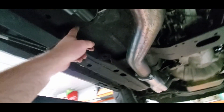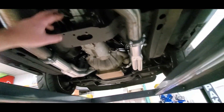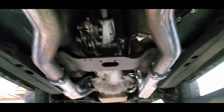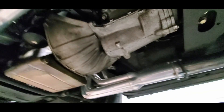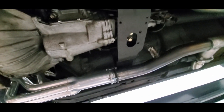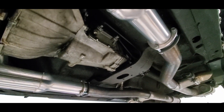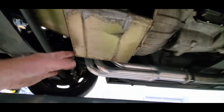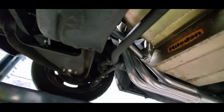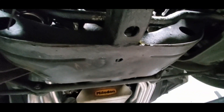Let's look at the wiring — I don't know where that actually goes, but all the wiring in this car is coming out. We'll change the seals while that's out. This is the TCC switch, and it's wet, so that's not good — we'll take care of plugging that up. That whole shifter is going to wind up getting cleaned up. I'm happy to see this is actually somewhat dry. But you can see it's wet up here — that front seal is not sealed. So all of that has to come out.